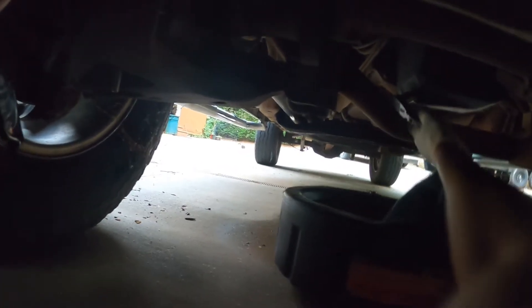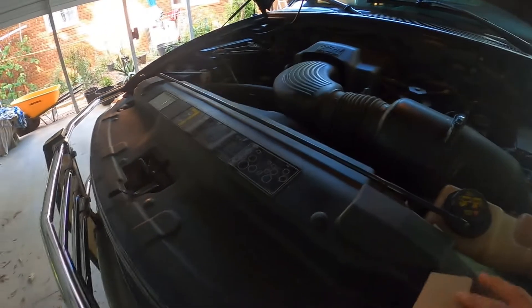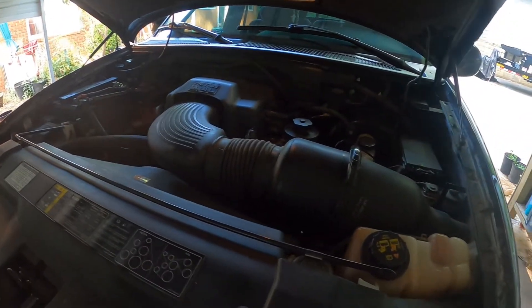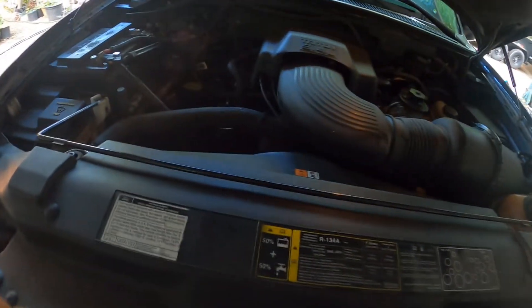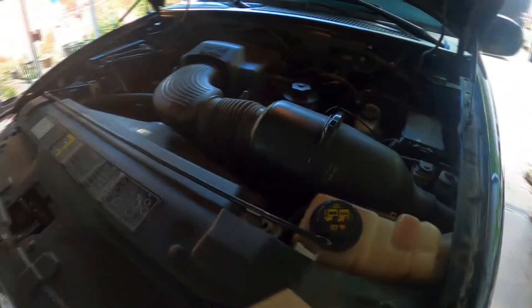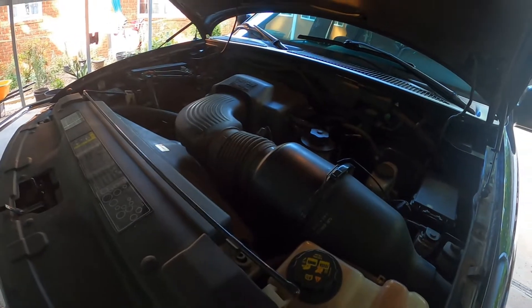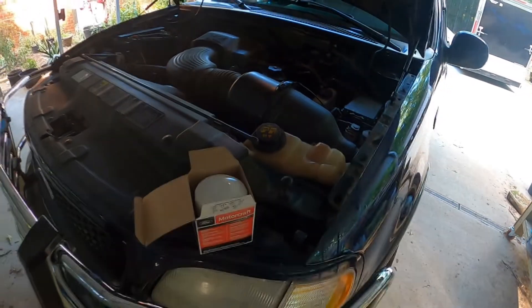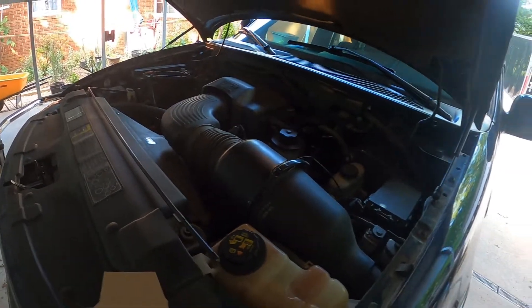This one takes a 16 millimeter socket. I'll run the Seafoam, drain it, and then refill with some cheap oil just so I can flush out all the Seafoam residue. Drive a couple of miles, then do a proper oil change and put the Motorcraft oil in. I probably didn't have to use that cheap oil, but it was just 20 bucks — that way I make sure to get everything out, since doing a regular oil change you don't always get 100% of the oil; there's always a little bit left in the engine.